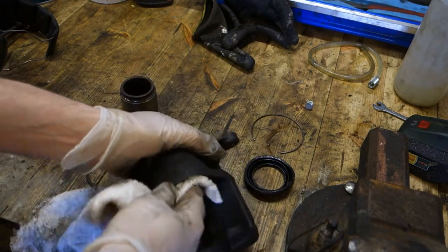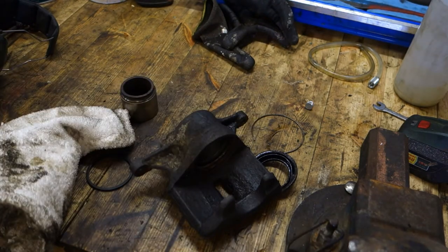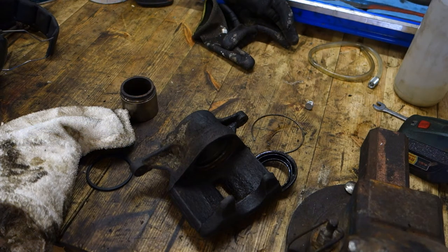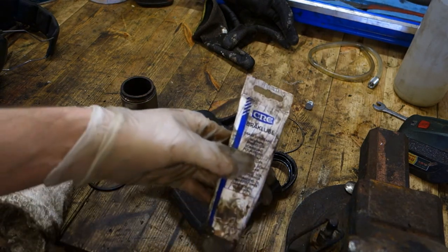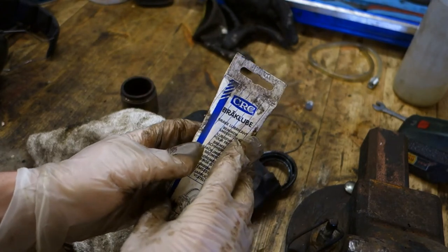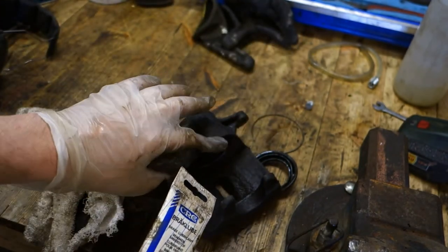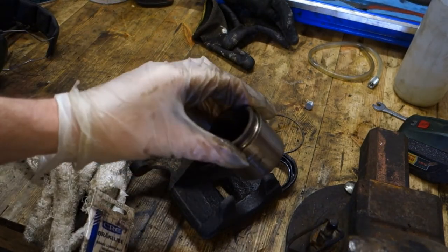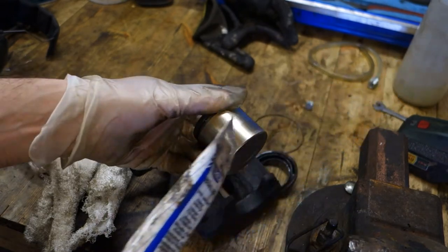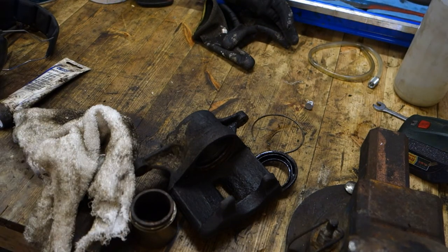And final step, when everything is clean, we can start to assemble these parts back. When I have cleaned all of this totally, then we also need some brake grease. And this is actually brake lubricant, and I have this specific grease. This is not standard grease, it is like brake lubricant, here I have one brand, and the idea is that this brake lubricant fits also inside the brake caliper and piston areas. This lubricant doesn't destroy the rubber sealant and gasket. That's the point. But I clean these things first, and then I insert this lubricant, and we continue.